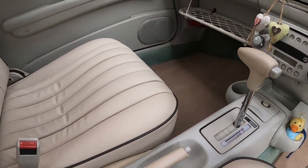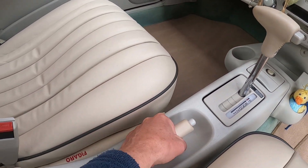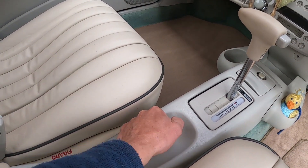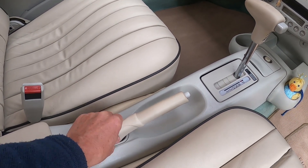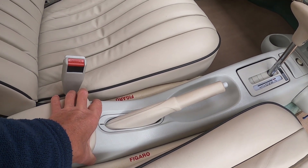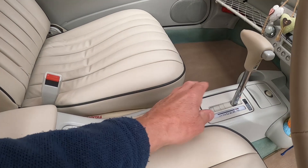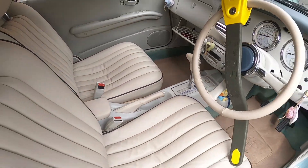The other thing is to make sure that the car is in the park position, but don't pull the handbrake up — leave it down. Don't pull that up because all that will do is possibly end up binding the drum brakes and you're going to have more problems, especially if you've left it for a long period of time. So definitely no handbrake — stick the car in park.